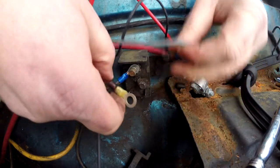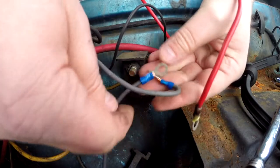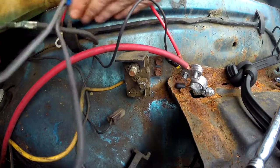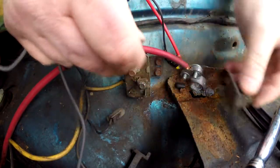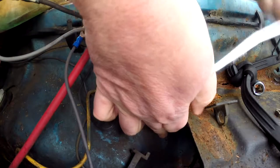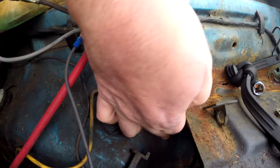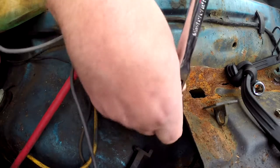There's one wire that goes to the battery and then there's the two fusible link ones that I just made. These ones here — go out the positive terminal there. I'm gonna rough up that area because I think this is the ground point. Without good ground that's not gonna work.